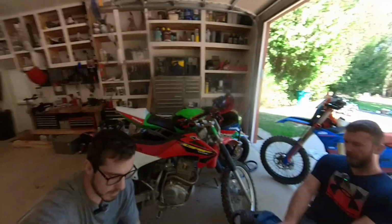But yeah, you got this bike from your friend who needed some help with some money. The only thing I would do different if I was actually looking for a bike in this category, this is an 03. In 2006, they started putting e-starts on. And the engines aren't easily swappable. Otherwise, I absolutely would buy some case halves from an 06 and build up this bike with e-start. But getting this bike to have e-start would be every bit as difficult as having one with upside down forks on it.